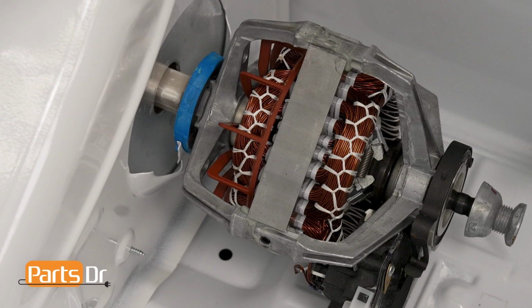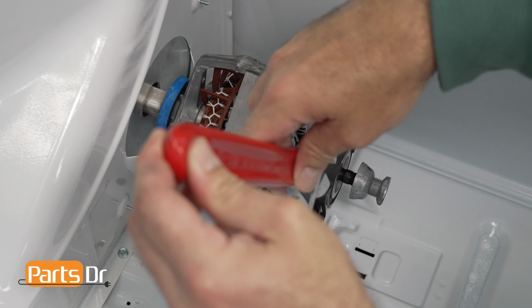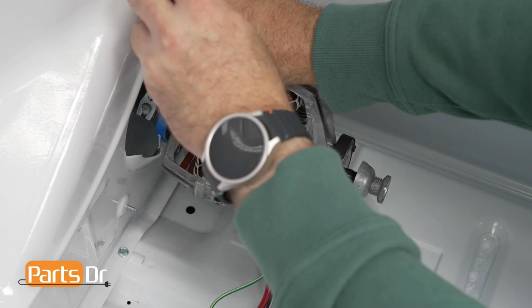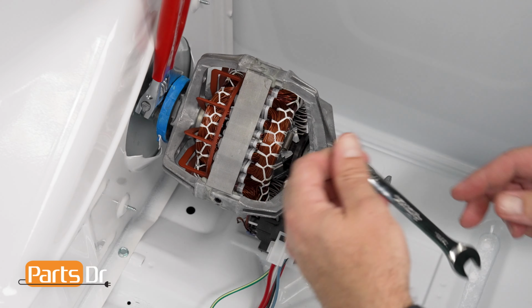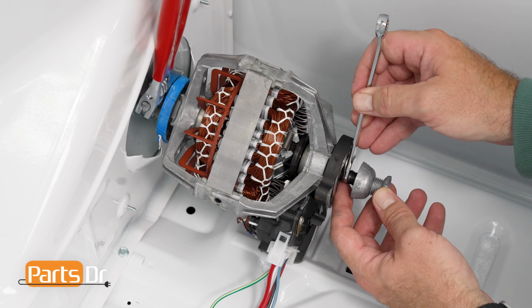Once the rear clamp is removed, you can see the plastic square nut on the rear of the blower wheel. One option to attempt to remove the blower wheel is to put an adjustable wrench on the plastic nut to hold the blower wheel while the 7/16 wrench is used to turn the motor shaft. There is a portion of the motor shaft that is flat that allows the wrench to attach to the shaft.